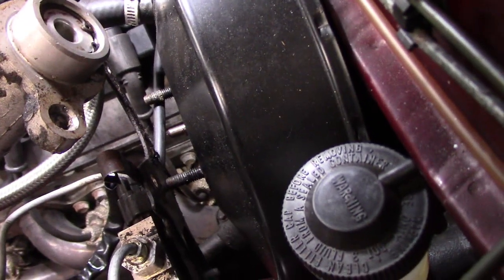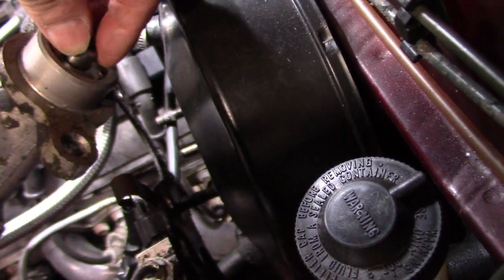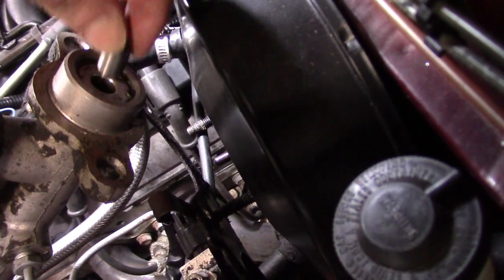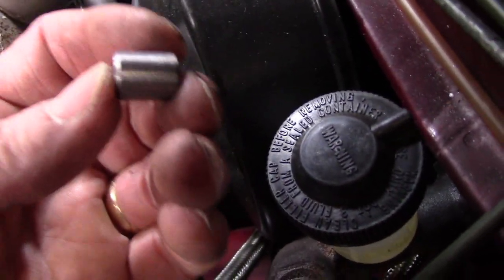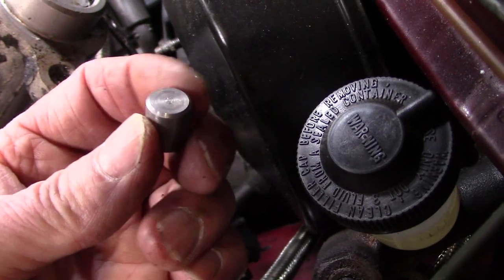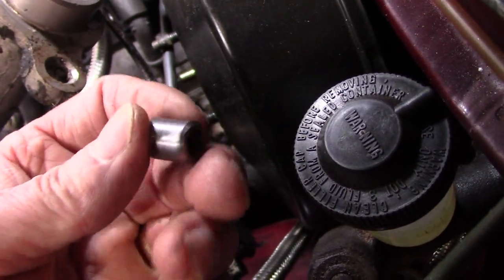I did some careful calculations based on the stock Mazda master cylinder and the Ford Explorer. This fits precisely inside — there's almost no slop, it's a nice slip fit. I put a little bit of synthetic grease on this several thousand miles ago. It's been probably eight months since I did this conversion and it was perfectly lubricated — no scoring or scuffing — and this system has worked flawlessly since the day I put it in.